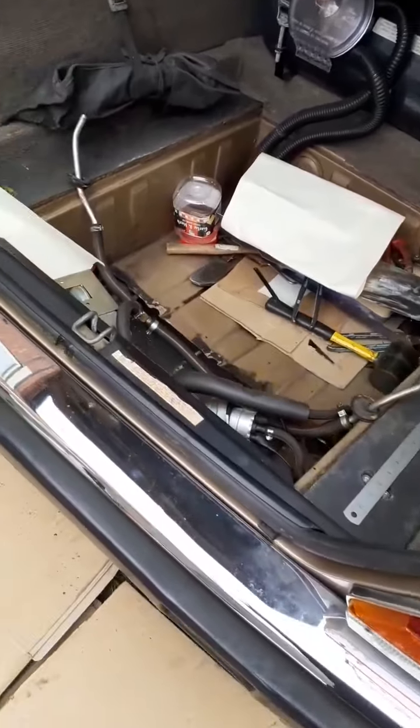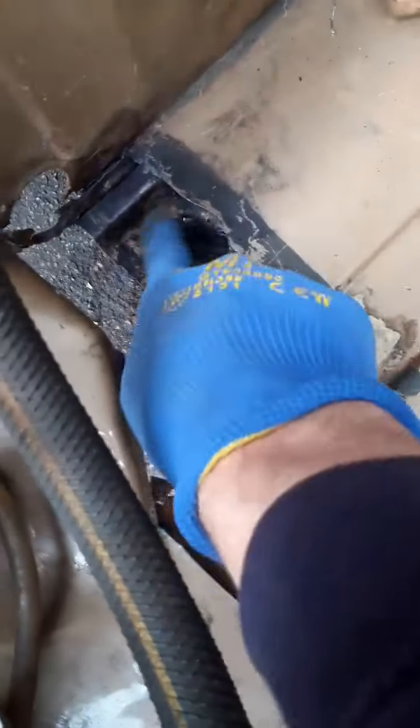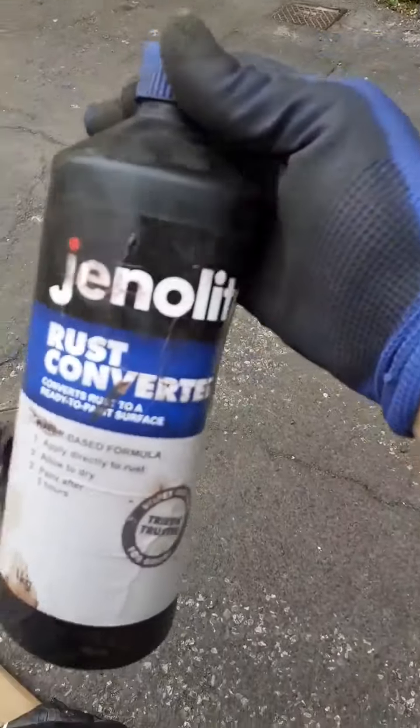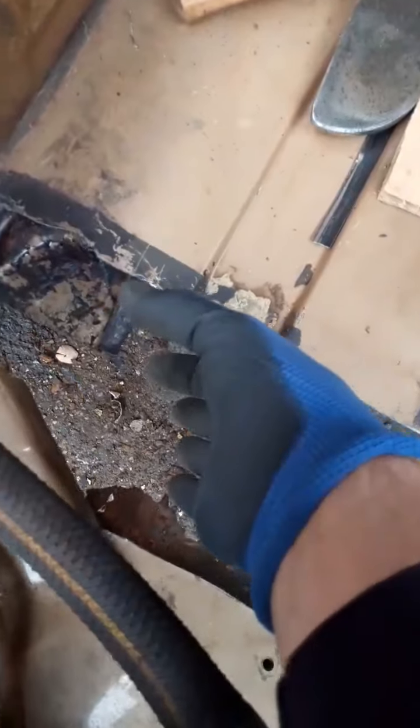Welcome back to BL's Above the Jag. I've treated all of the areas with Genolite rust treatment — they're all inside here. This metal is all decent with that surface rust. It's just a Genolite rust converter. I'll leave that to dry, and then what I'm going to do when that's dry — I'll come back to it probably after 24 hours — I'm going to spray weld-through primer because we'll be welding back onto here, but I don't want any traces of rust, so I'll leave it now.